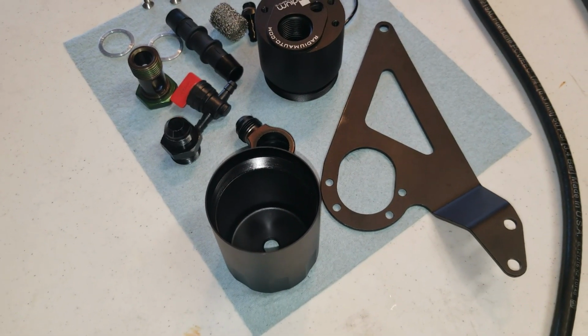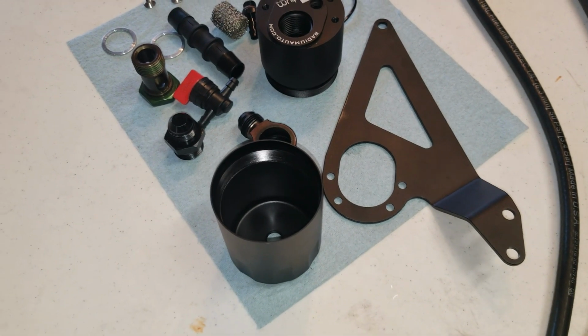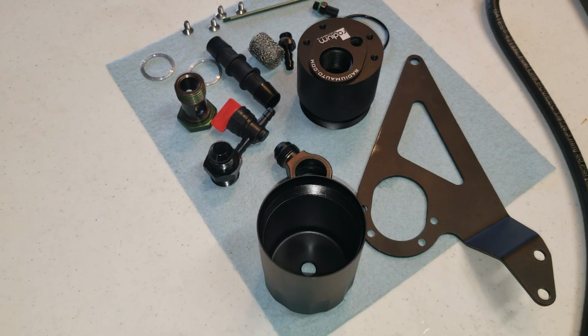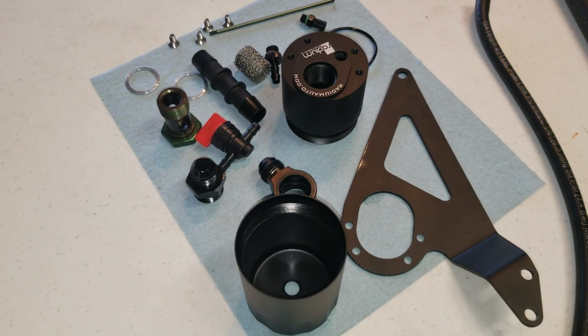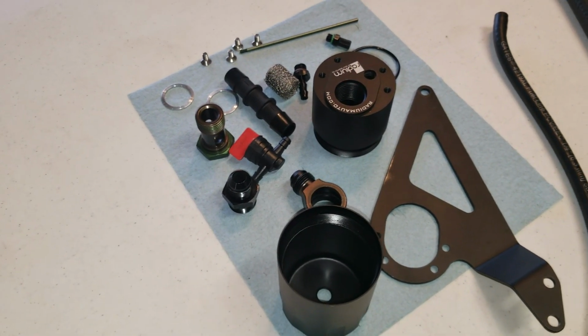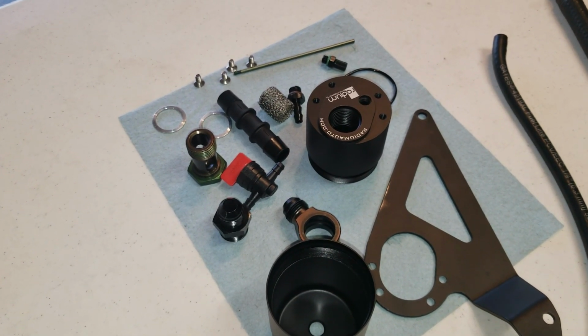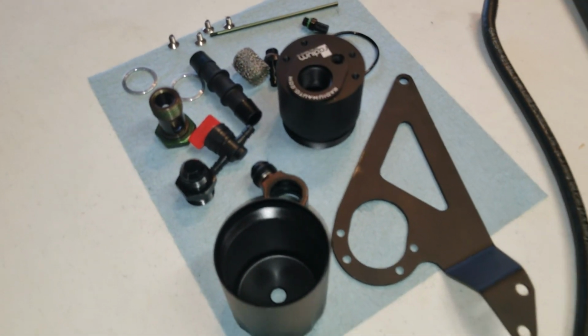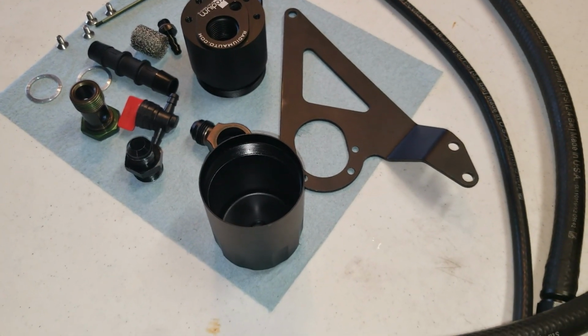And what makes it important is that you want to have a really clean combustion inside your pistons rather than oil or oil vapors or whatever crap that comes into the PCV side of the crankcase. And just an extra peace of mind and reliability and maybe even performance is always nice to have.